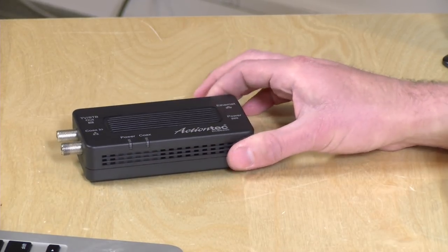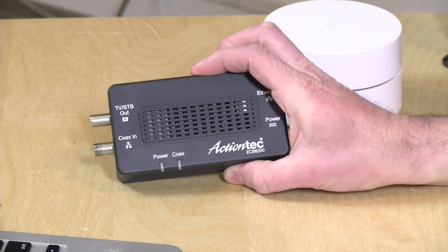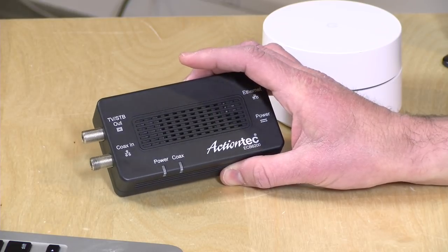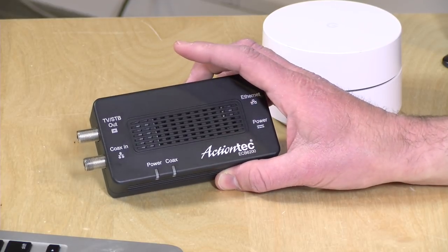We've got a lot of data to go over and I will compare this to a Google Wi-Fi mesh system that I also tested. You'll see how extending your network with a wire is going to be better than relying on Wi-Fi signals going from one end of your house to the other. I say 'with a wire' because ethernet is certainly the ideal networking scenario, but what MoCA really benefits by is the fact that if you have cable TV wiring in your house you can get similar performance without having to pay an electrician to wire everything up — it's the next best thing.